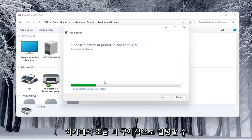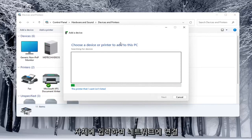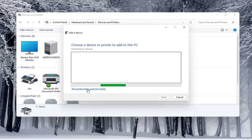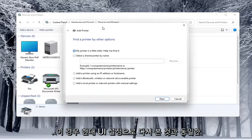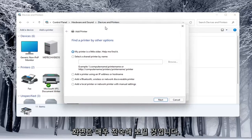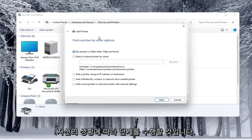This will be a little more specific — it will check if your printer connects to your Wi-Fi. Make sure your printer is turned on, and if it is a wireless printer, make sure you've typed in your Wi-Fi credentials into the printer itself so it's connected to your network. If it doesn't populate in the list once it's done loading, you can select that the printer I want isn't listed.